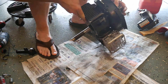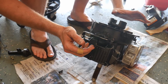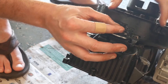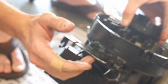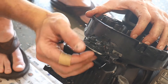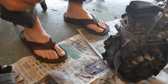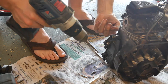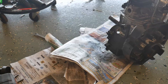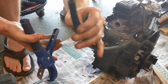We forgot to cover the kill switch. The way kill switches work on these is the coil basically grounds itself out — this little wire just tucks under here and it has a spring-loaded mechanism with a shoe that brakes the flywheel and grounds out the coil. For the oil fill, all I'm going to do is drill this out. Sometimes the simplest solution is the best solution.